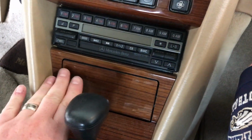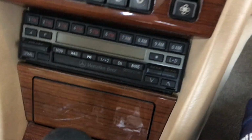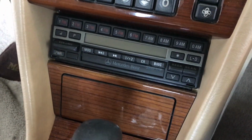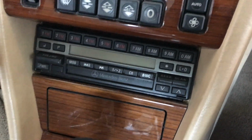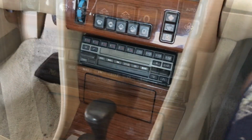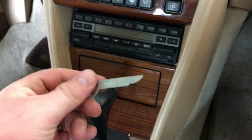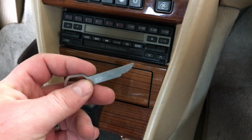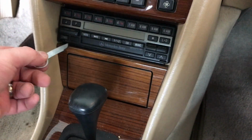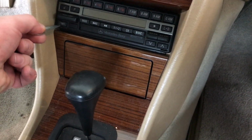Now, first things first, as we go ahead and remove this radio, you're going to notice this one has little slots below each part of the radio, and we have keys that we're going to slide in there to release the clips on each side of the radio, allowing the radio to slip on out. Now the keys we have are these European keys. I can post in the description where to pick these up, but essentially, as you can see here, it says top left, meaning this side up, and on the left hand side.